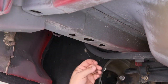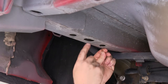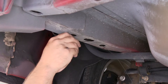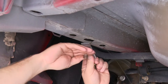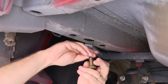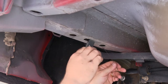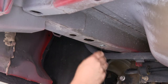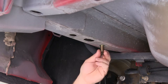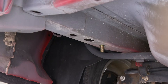To install our hardware at these locations, we'll take our bolt leader, go through the mounting location, come out the access hole, take our square hole spacer block followed by the carriage bolt, put those both on the bolt leader, push them both up into the vehicle's frame, and pull down into position. We'll repeat the same process at this location as well as the two over on the passenger side.